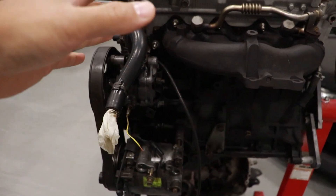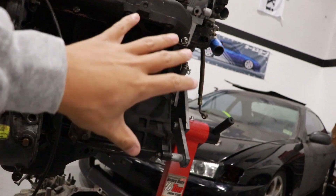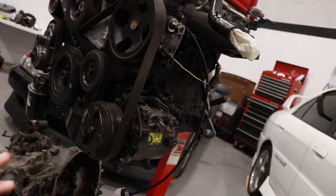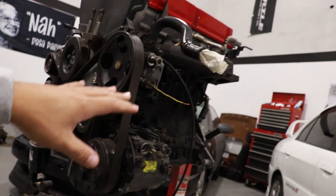What I'm going to do today is install the turbo onto the manifold and then button all that up. I'm going to have to go get a new gasket but that's not too bad because it's only four dollars from AutoZone. So I'm going to connect all the lines and after that go ahead put on the transfer case to the tranny, tranny attached to the motor.